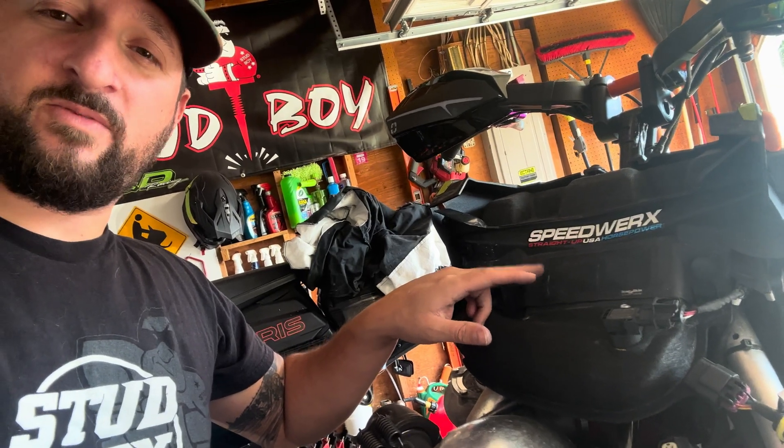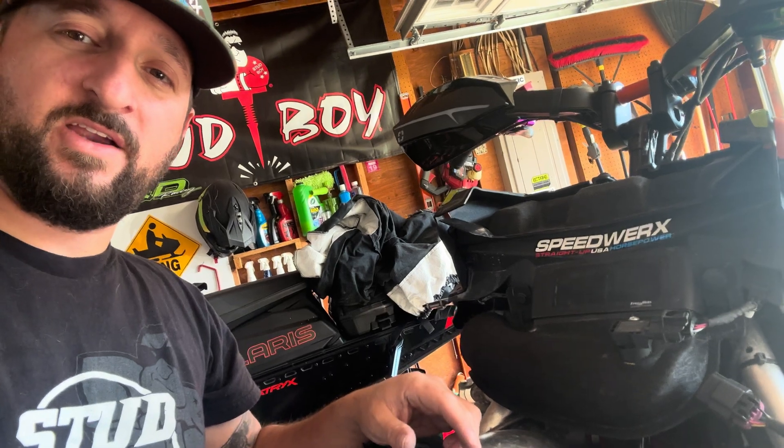Now this intake here I've been running for the last year. I don't run into deep snow — everything is predominantly trail riding, lake racing, stuff like that. But when I was dynoing I noticed that my intake temps were down, so it helped have a more accurate reading when on a dyno machine as opposed to being in the cold, just out trail riding or racing.